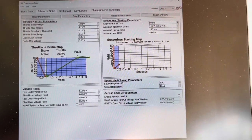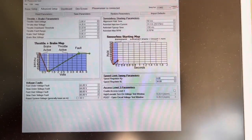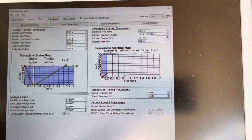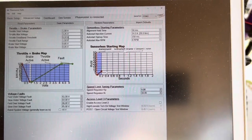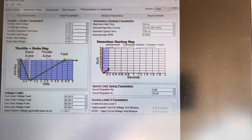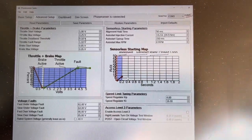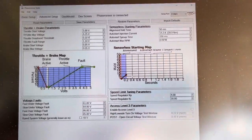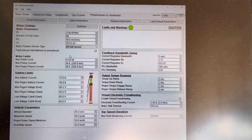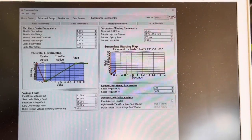You may or may not want the bike to respond to such small changes — it might make the bike jittery. Personally I found 0.10 volts in the dead band to be perfect; it gives me a nice smooth feel without bumps causing the throttle to come on. The sensorless start is essential: if the motor faults the sensors, it defaults to sensorless, and this is how much amperage it applies to get the motor spinning to detect the hall sensors. I'm using hall sensor for the motor position type with fault to sensorless.